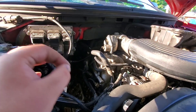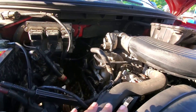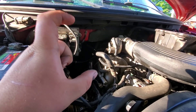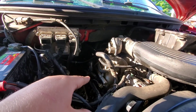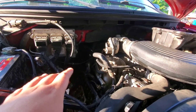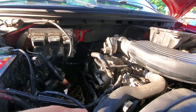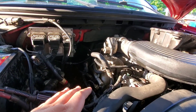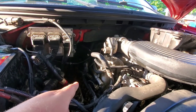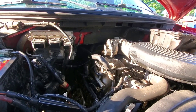Now this is a 4.6 2-valve. There's the 2-valve and the 3-valve. The 3-valve is the one that has that really long spark plug that's known to seize in the head and break. The 2-valve just uses a regular spark plug — there's nothing special about it. This is the same engine Ford's been running since about '94. It used to be the PI, then went to coil-on-plug around '96 or '97. I went to pull the plug on cylinder 3 because it's blown out a couple times, and I wanted to inspect the repair, because a lot of times I run into people using cheap inserts — if it was a poorly done repair, we were going to redo it while it was here.